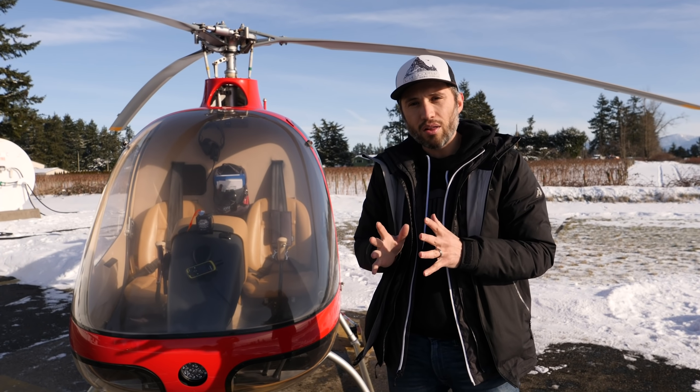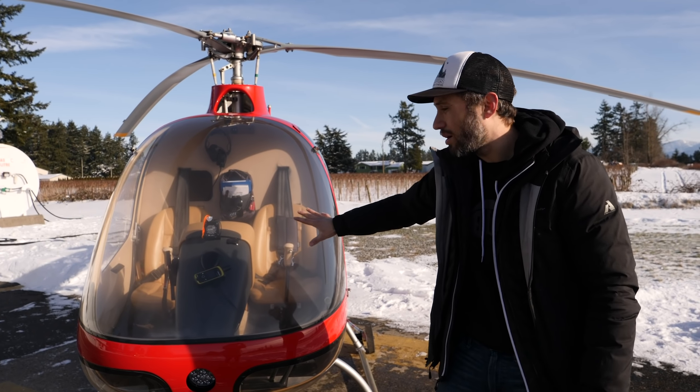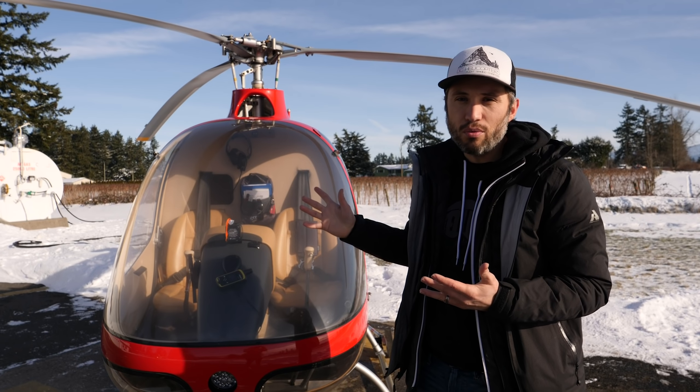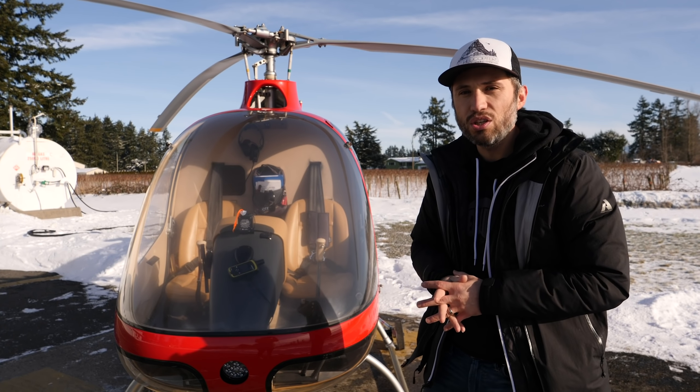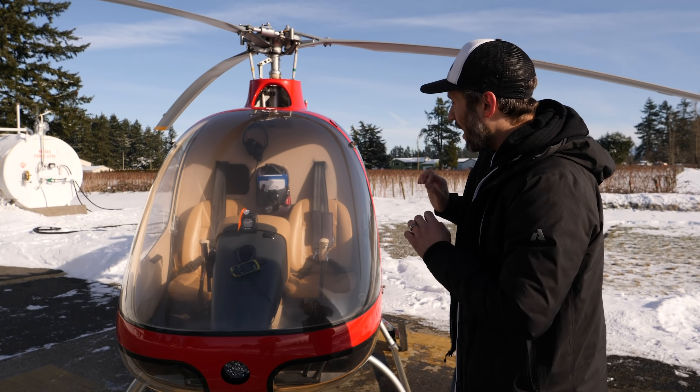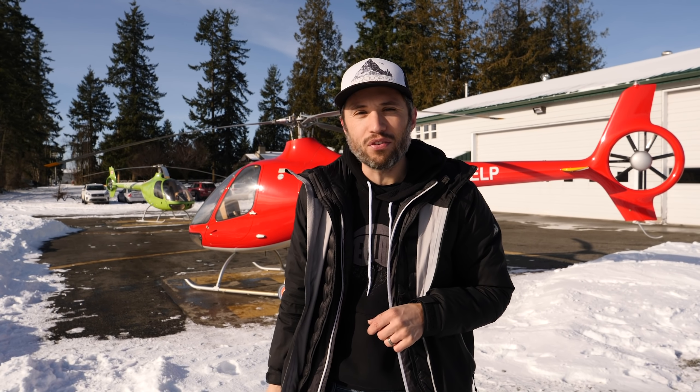Feature number nine is these modern crash attenuating seats. These seats are mounted on special rails that have the ability to crush — there's a full crush zone underneath. They've tested this: if this helicopter were to crash in autorotation — engine quits, helicopter descending at 2,000 feet per minute, you don't flare, you don't pull up on the collective, nothing — and you just impact the ground at 2,000 feet per minute, these seats would compact down on the rails. Technically, they say you're not going to break your back, which means there's a good chance you'll live through that. That's amazing — one of the best features of this helicopter.